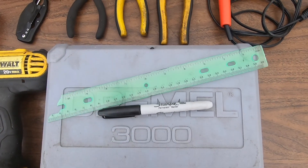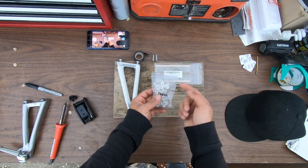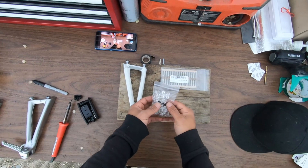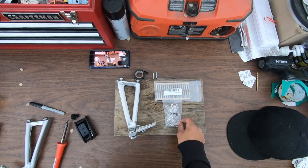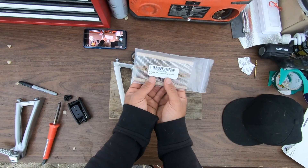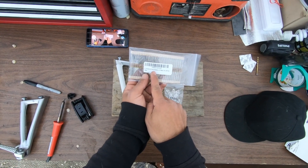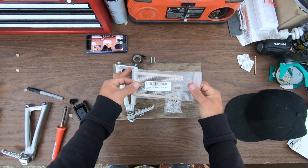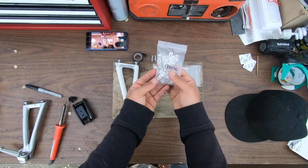What we have here are 8mm half-watt orange LEDs - rated close to five volts. But you can't just wire these and plug them into your motorcycle's turn signal system because they're going to burn out after about three seconds. You need to limit the current that gets to the LEDs, and for that you need 470 ohm resistors rated for half a watt - the same as these LEDs. I got a hundred of them for around six dollars on Amazon, and the LEDs on eBay for about five dollars for fifty.